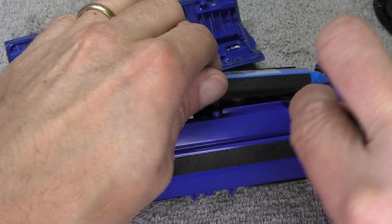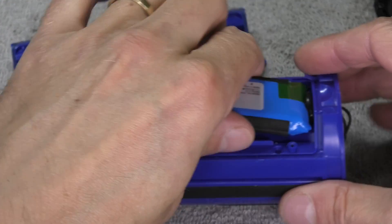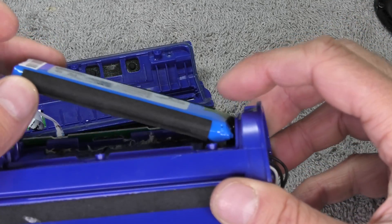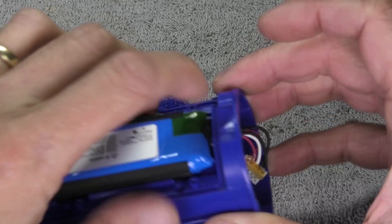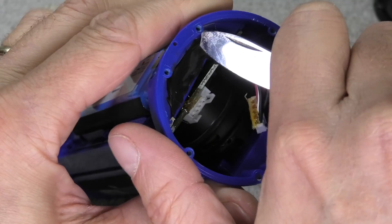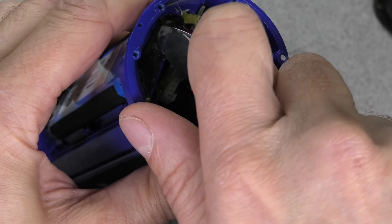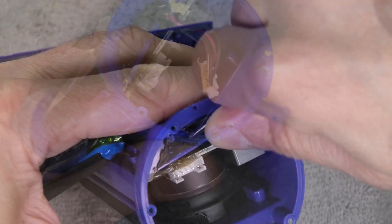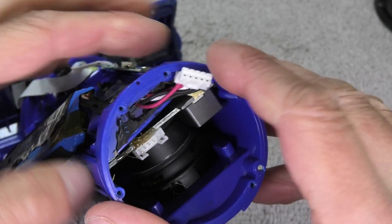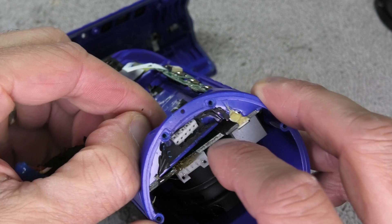Again, be really careful when you do this. Now the battery is loose, but there's still the harness — the wires that go to the connector. There is a lot of putty here; you see this black stuff, and that still holds the battery and cables in place. We need to remove this, so I'm going to cut it out and use a screwdriver to scrape it off. Eventually you'll have a hole just the size of the connector so you can squeeze the connector through the hole. And now we have removed the old battery.